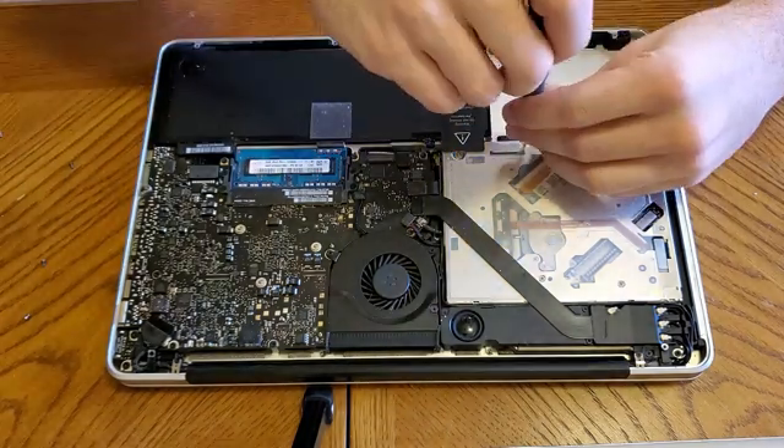So now we're going to lay our piece down and plug it in. You want to be gentle with this — it should snap into place and you shouldn't have to force it. It's already snapped. Before I take off the adhesive or anything, I'm going to go ahead and screw this cable in. It's kind of a hard thing to do. It also helps that I have this magnetic tip screwdriver. If you want one, look in the product description — I'll have the screwdriver and all the tools and everything. Make sure it's laying flat. You don't want to make it too tight because you can cut right through the cable.